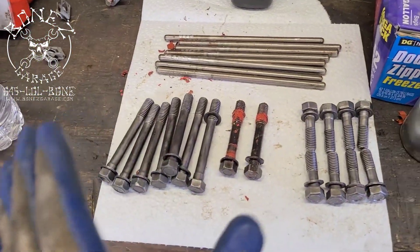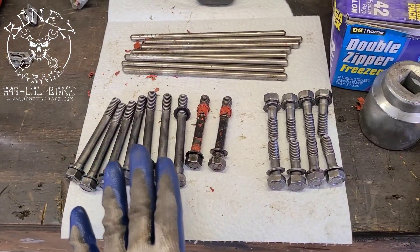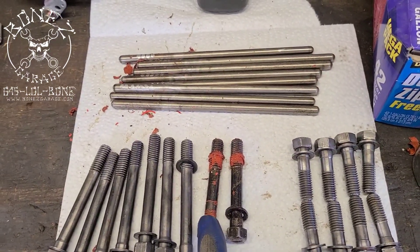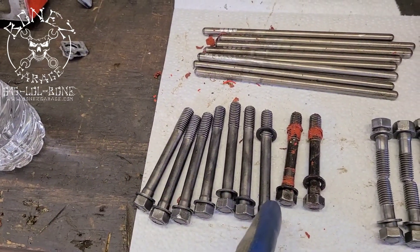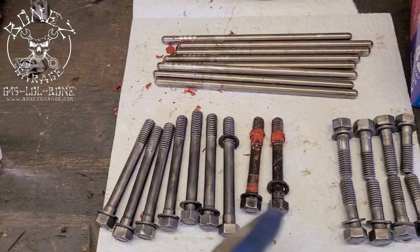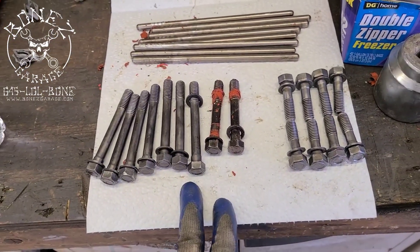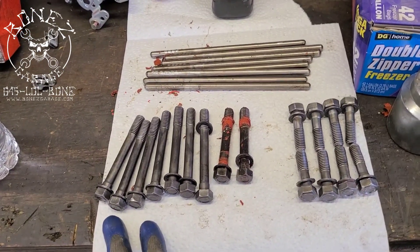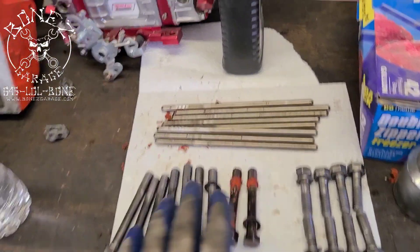Here are all of the head bolts. Again, this is a budget motor so we're trying to keep the cost down. We're using the head bolts that came out of the motor — that's what we're putting back in. It takes about 10 minutes to do all these bolts: just take them to the wire wheel, get all the crap off of them, and stick them back in. He told me they had just put these bolts in and he'd rather not buy another set — they get expensive, you know, a little bit at a time everything gets really expensive.